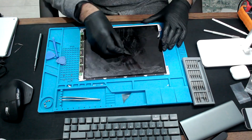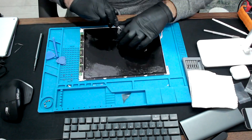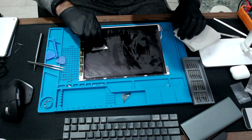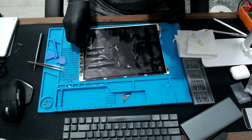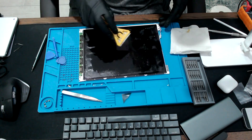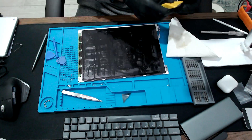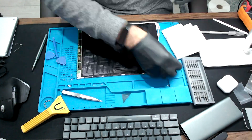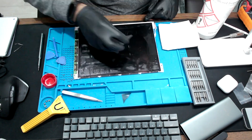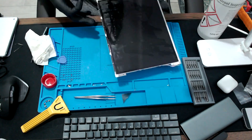Now that the old polarizer film is out, the tedious task of cleaning the remaining glue starts. This is by far the most boring part of this fix — be sure to put some music or a video on in the background while doing it. For the cleaning, I start by pouring some 99% isopropyl alcohol on it and letting it soak for a bit for the glue to start getting softer and easier to remove. I then use both the blade, being very careful not to scratch the glass, and paper towels to help remove the glue. I repeat it many times, being really patient until the screen looks clean. At times it may feel like you are making a mess and not getting the screen cleaner — just keep going. Pour more isopropyl alcohol, remove with the blade and paper, and repeat over and over again. You'll soon see the results.